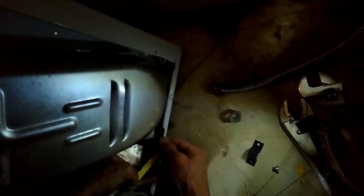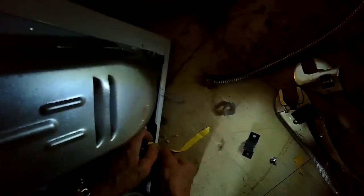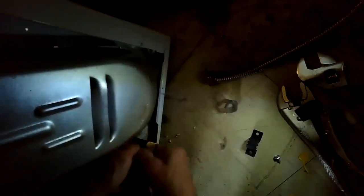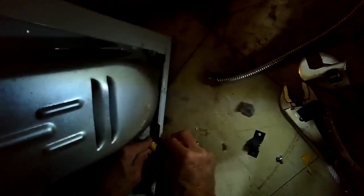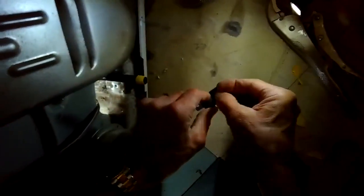So on the back, we're just going to put that bracket down on the gas valve. There's 2 screws holding it in. We're going to put on some of this Teflon tape on the threads of the new gas pipe. And this is the yellow type of Teflon tape. The white stuff's for water, the yellow stuff's for gas, so it's a little bit thicker. So I'm putting it on the threads, and then I'm going to kind of squish it on, and then I'll take the adapter and I'm going to feed that back on.